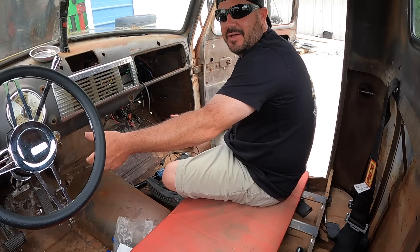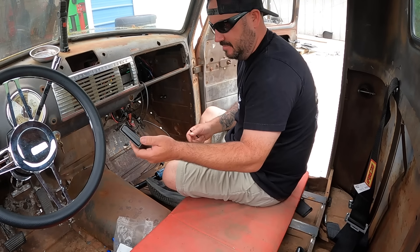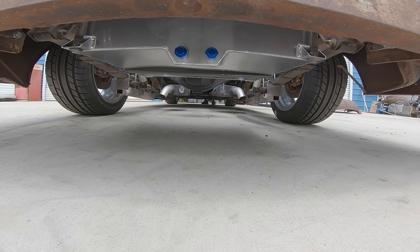Yes! Before it didn't run for longer than three seconds. That seems good. With the Holley Terminator X, once the engine sees 160 degrees it'll start self-tuning. So I'm going to let it sit here, let it warm up, do its thing. Once it does that we'll go drive it up and down the road, see if the transmission shifts, and see if we need to make any fine-tune adjustments — which I'm sure we will. But it definitely runs better, it runs longer than three seconds. I figured the MAP sensor was the issue. The same thing happened with my Mustang. So I'm glad we got that sorted out. Let's let it do its thing, I'll check all the fluids, then we'll go drive it up the road.